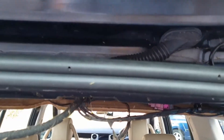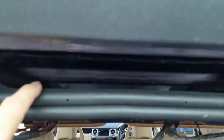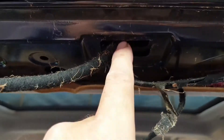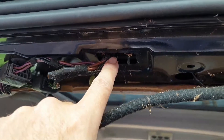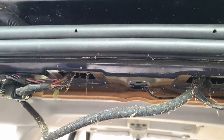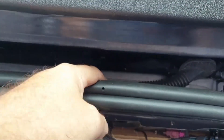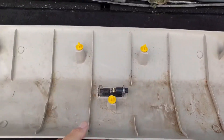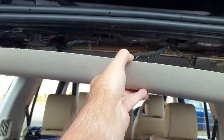...in the top here where you've got these looms coming down, you've got one each side of the tailgate top. There's a couple of rubber grommets — quite large — that are sealing this hole. Both of mine were out, so basically when the water was hitting the roof, it was dripping straight through here because these grommets were not in place properly, and it was filling up this panel, which is the interior light enclosure that goes on the back there.